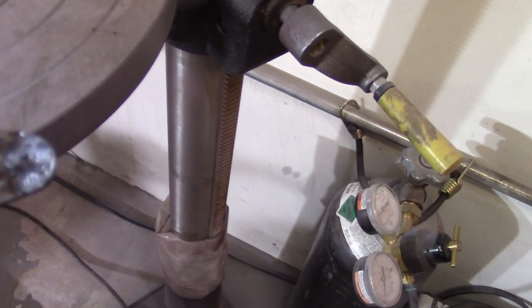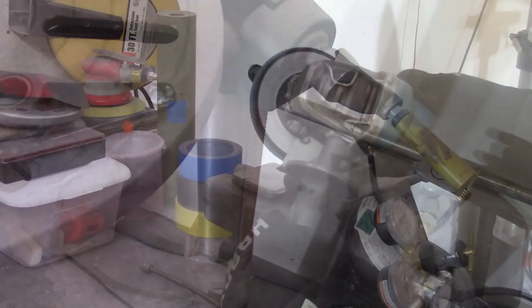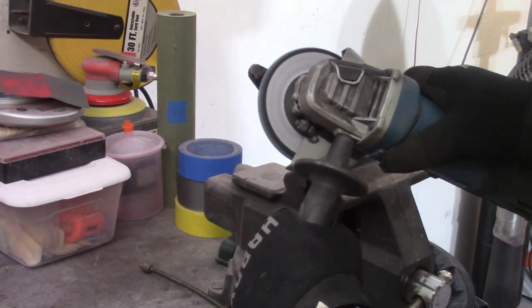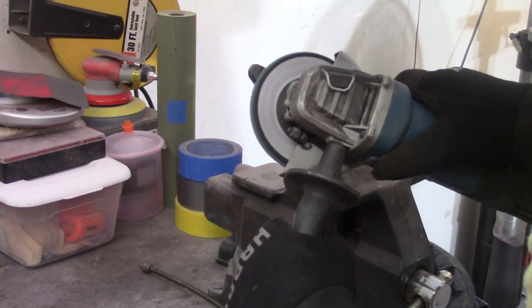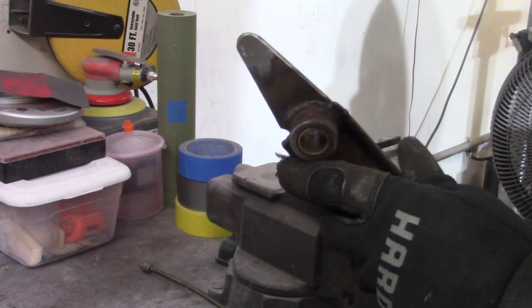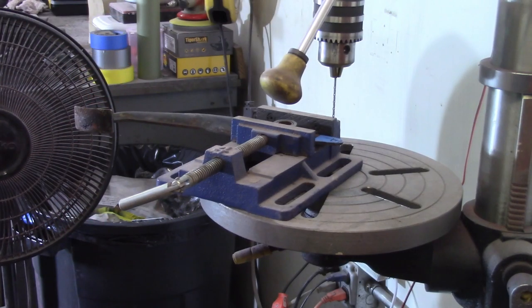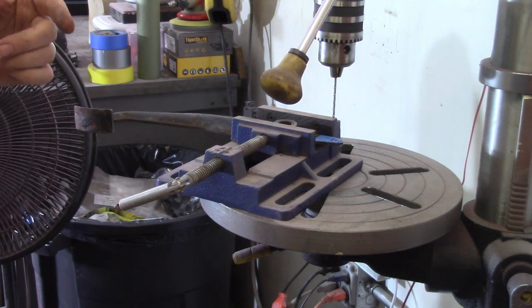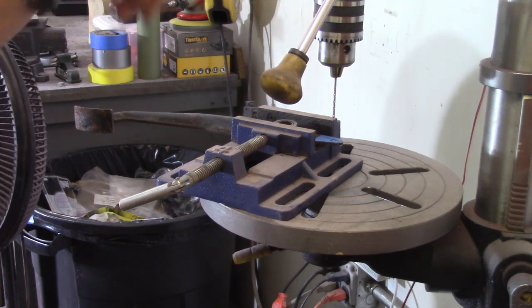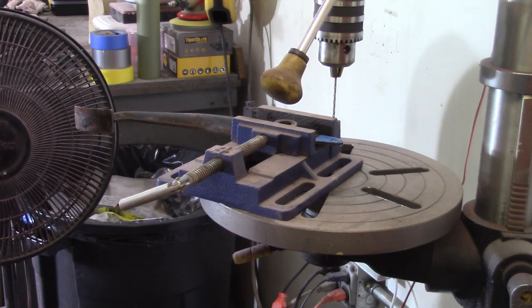All right, that's all filled in. Now I'll grind it all smooth and drill it out. Not perfect but I don't care. Now I'll put that piece of tape back on there. Since this is such thick metal and because it's weld metal in there - which is a little bit harder than regular metal - I'm going to step my way up, start a little pilot hole and work my way up before I get to the five-sixteenths of an inch that's required.